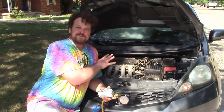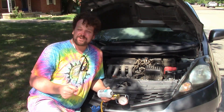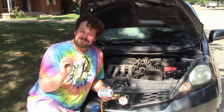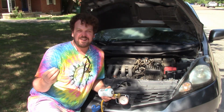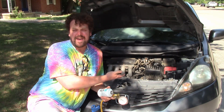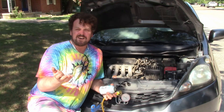The symptoms we have with this car are simple: when it's hot outside it doesn't cool off very much. The air conditioner works when it's 80 or 90 degrees — it takes the humidity off — but it's still kind of warm. We have a lack of capacity, so we're going to add more refrigerant to the car.